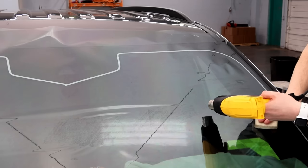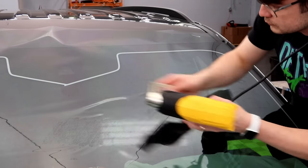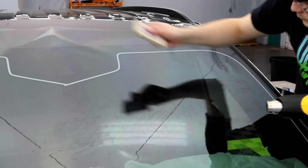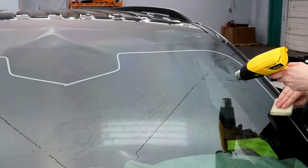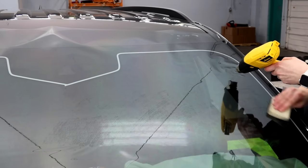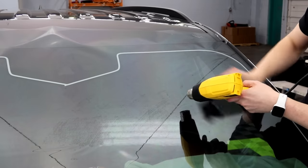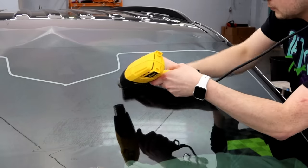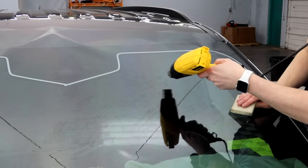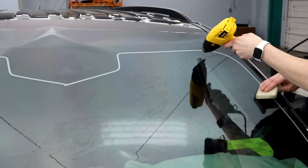I didn't want to forget the shrinking portion — I know that's always an important thing to show. Being that we did a 50% ceramic, it's going to be a little more challenging to show some of the nuances. The Explorer windshield is not exactly a super difficult windshield to shrink, so if you have one of these you should be happy, especially for the installation portion. I've had quite a few Explorers lately and they're just all around a more straightforward windshield than the Audi A4 windshield I did immediately after this one.